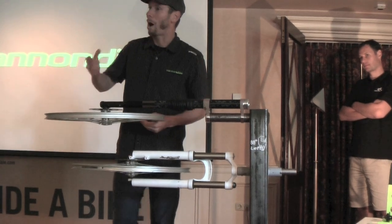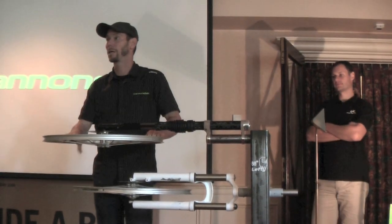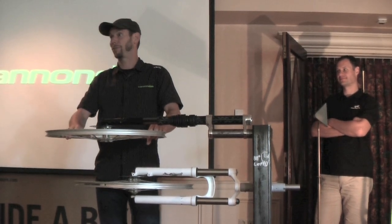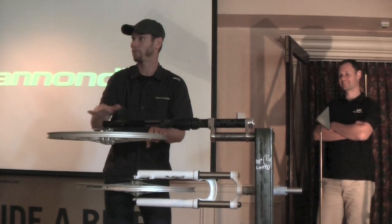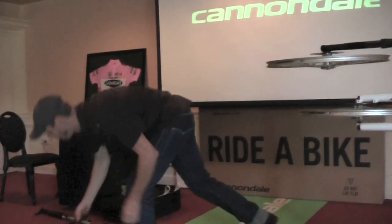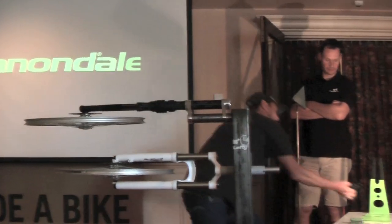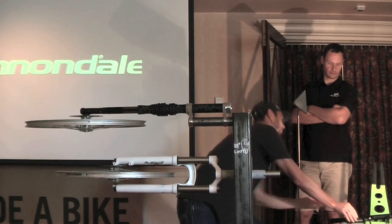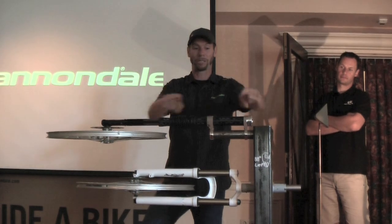Okay? And this is the benefit for the rider, when the customer says, "That doesn't work." And then you say, "It does work," and they say, "Why?" And you say, "Because it's stiffer." You can explain it's stiffer because of these points, and everybody who's somewhat technically minded will see that this is definitely stiffer than clamping the axle right here. Okay, that's a no-brainer. Then when you go to the oversize, you got the square and square, and then you got the oversize, you got the double clamp.